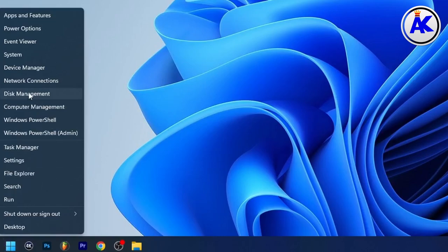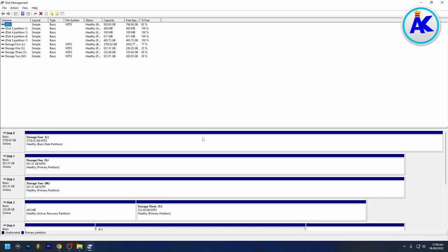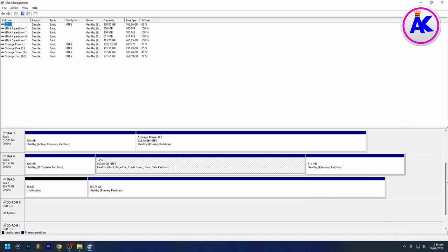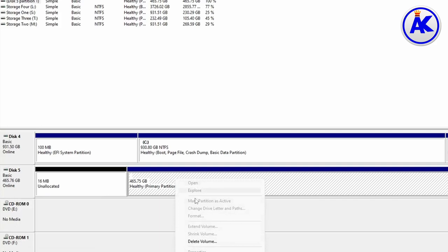On Windows 10 and 11, right-click on the Start button and go to Disk Management. It'll take a few seconds to load, and then towards the bottom it should show your hard drive. Make sure you've got the correct hard drive selected, because you don't want to accidentally format another drive on your computer and delete files — check the capacity to make sure you have the right one.